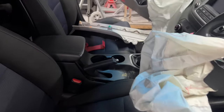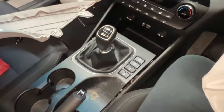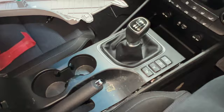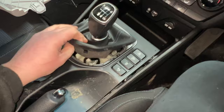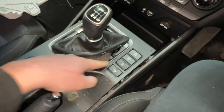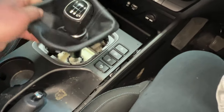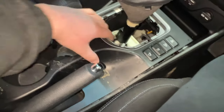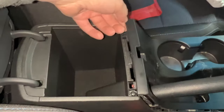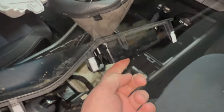I'm going to be starting off with removing the centre console, as on this car you do need to remove it. So to remove the centre console, the first thing you want to do is remove the gaiter for the gear stick — you can get a pry tool in and this will just gently pry away. When that's done, I've got my hand here and slightly pulled around this area and it separates — there's one plug just here.